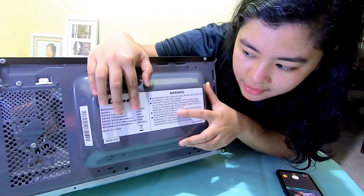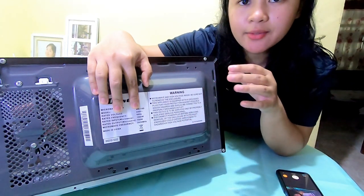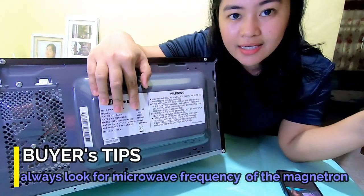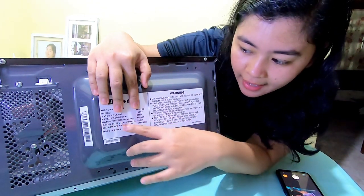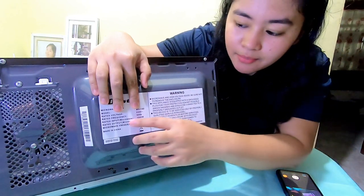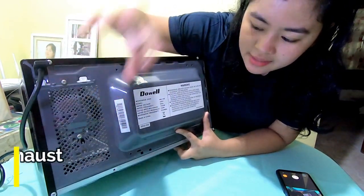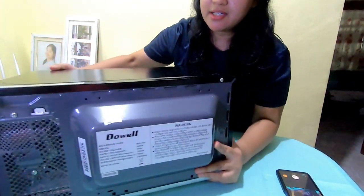Again, this is a digital microwave oven — the frequency spec is important. For the rated input microwave power it's 1500W, and for the rated output microwave power it's 700W. The microwave frequency that the magnetron produces is 2450 megahertz. We base our evaluation on these specs — so if you see in the market one that's expensive yet smaller versus a cheaper but larger unit, check the magnetron and check the output power. The output power is the actual heating capability of the unit, while the input power is the power consumption.